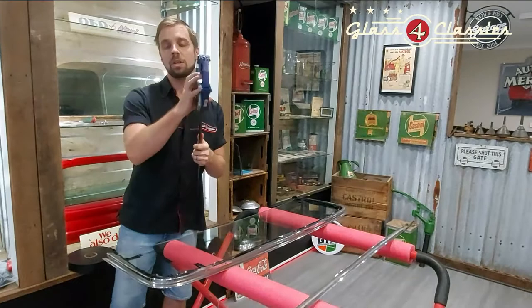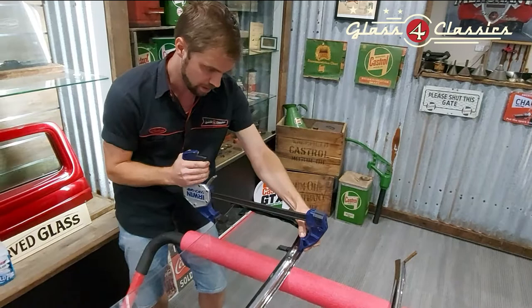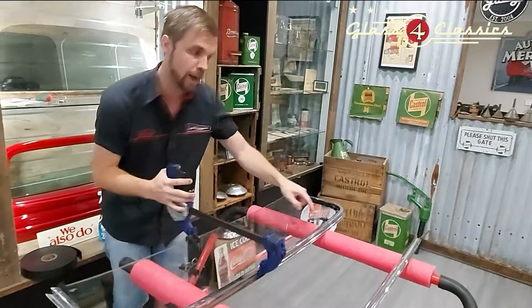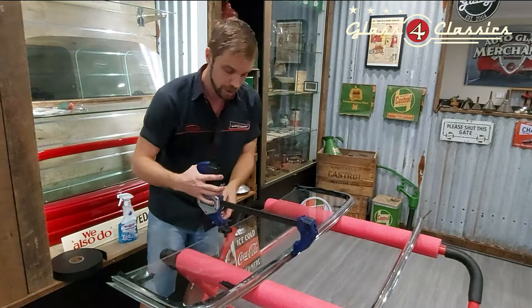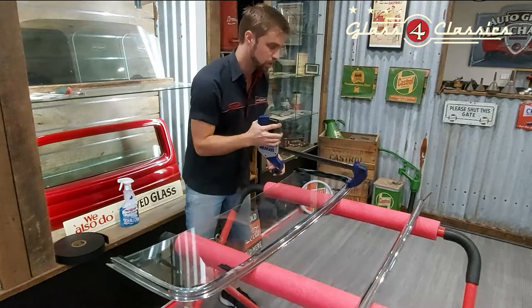Put this upside down. We've got one of the Irwin quick-grip clamps — you can use a rubber mallet but be very careful, as this is laminated glass and it is more prone to cracking. We have a little piece of rubber to sit over the edge of the glass. Sit this on the edge of the frame and pull it in. Don't try to pull it all in one go — work it a section at a time. We're using a paint stand; most of us have one at home. Grab a $2 pool noodle, put a cut down the middle, and sit it over — it's nice and soft and you will not scratch anything.